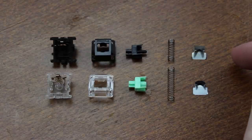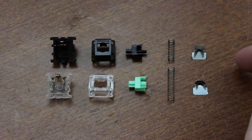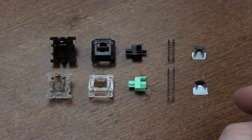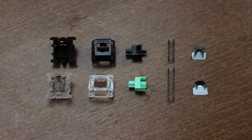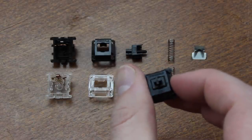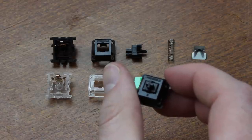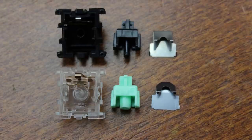The actual parts themselves are similar to but mostly not interchangeable with Cherry MX parts. This idea is actually not new — in the mid or late 80s there was a very obscure and extremely rare type of Cherry MX clone which worked in almost exactly the same way: the Pro World clones, which are similarly an Alps style click leaf in an MX type housing. These come from an unknown manufacturer which presumably also made the Key World and Pod World switches. They were found in old SKB and PDC keyboards, also made by an unknown manufacturer. I've managed to secure two of the Pro World switches courtesy of VintKeys.ca — link in the description.